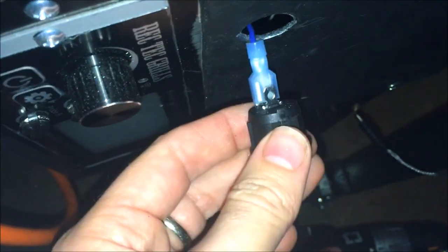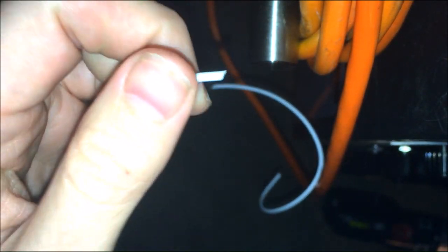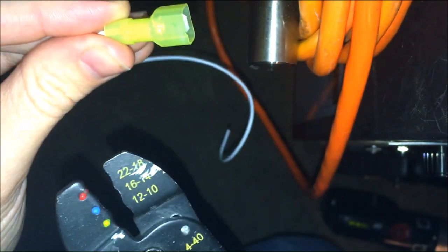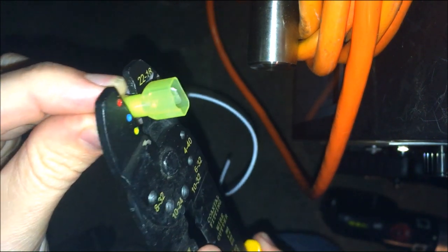On one of the wires you're going to want to crimp on a female connection to plug into the male connection of the switch. For the neutral side I pulled out a length of white wire to plug into the white wire of the RecTech harness. A lot of people know how to crimp these type of terminals to wires so I didn't record a lot of that, but if you need to reference something here's me making up the white neutral wire. The yellow terminals are meant for a slightly larger gauge wire but to make it simple on myself I decided to go with yellow instead of blue so that I knew which connection was which. After giving it a tug test it seems to work just fine.